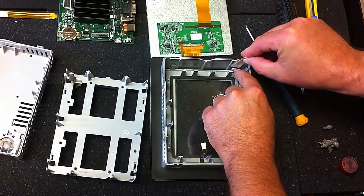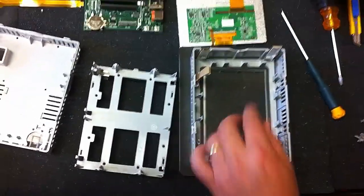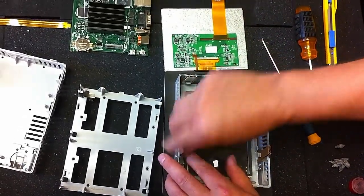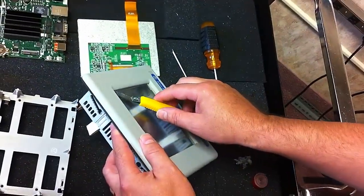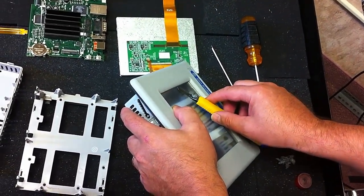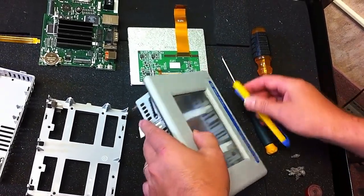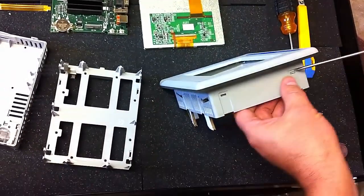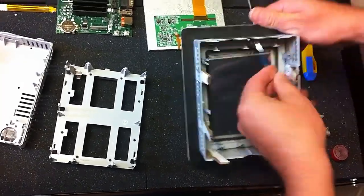Just take some cardboard strips and put them along the edge here. These are your little tabs — they'll help you instead of trying to deal with them constantly popping in and out. What you're going to do now with a knife — be very careful, always cut away from you — you'll end up pushing down on the glass slightly and slicing the rubber. Always try to cut down and away from you, slowly pushing it down until finally it gives away and pops out.